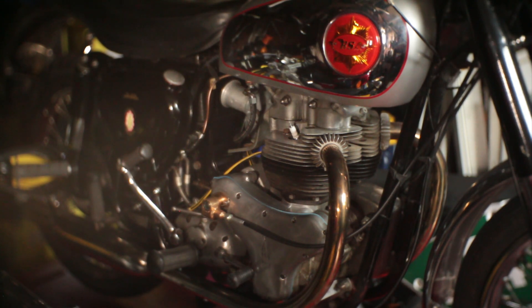So yeah, this is what I'm going to be up to. I haven't finished the other bike at all yet, of course, but this is kind of the next project. The next video will be getting the engine out, putting it on the stand, taking it apart and having a good old look. The only way it could go differently is: before I take the whole engine out, I'll probably take the rocker box and head and barrels off. And if I see anything obvious there that I can fix, I might not take the rest of the engine out. But the sludge trap thing — I really think it needs to be looked at after all this time.